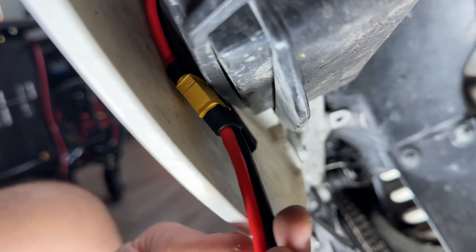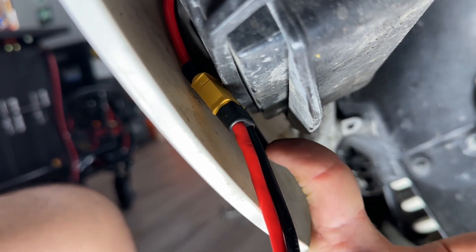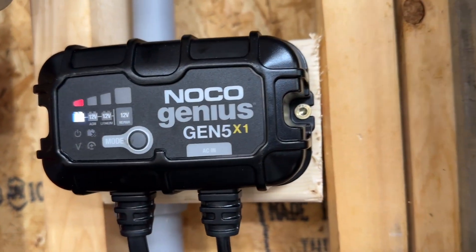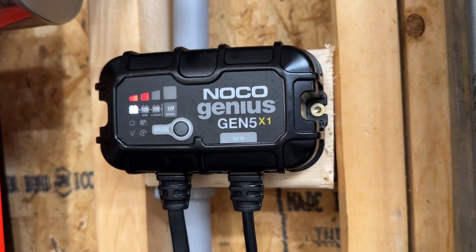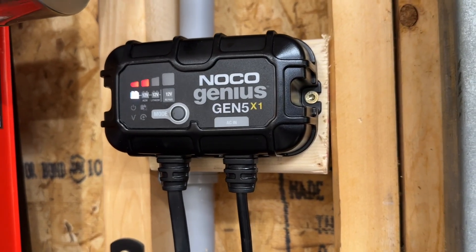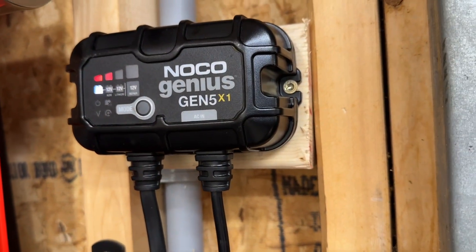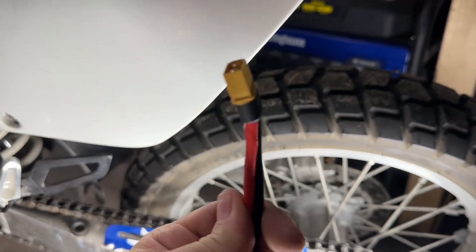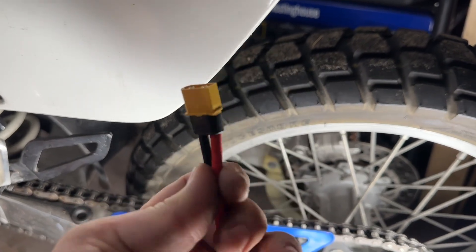You can also get little covers for these XT60s, so if you're out ripping around in the mud you can waterproof it pretty well with a waterproof cover. And there it is — it goes up and into the NOCO Genius, and that'll put on a nice slow trickle charge overnight and get it all charged up. You can also keep it plugged in all the time on this thing, just like a battery tender. It's a much quicker system because right now it's plugged in — say it's done — I don't have to worry about taking any fairings apart. I just pull it, because these things just slip in and out. It's just a better way of doing 12-volt top-offs like this, because these connectors will carry the amps and volts no problem at all.